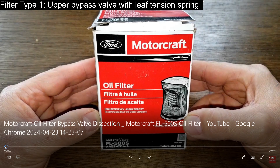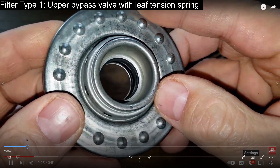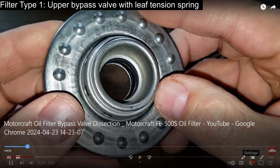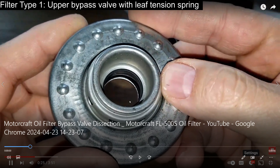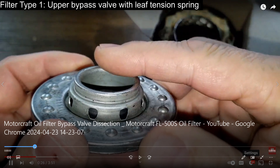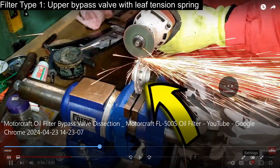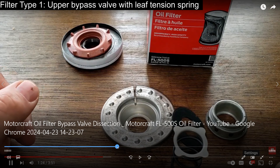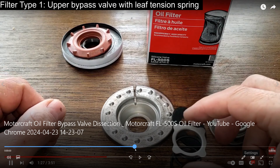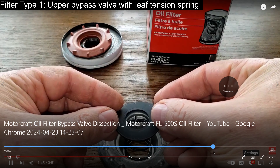Unfortunately I don't have examples of number one where there's an upper bypass, but here's Whip City Wrencher - I'll put a link in the description to his YouTube page. If you want to see all about oil filters, this is the place to go. So this is an upper bypass relief valve. You can see here he's showing it in this example, and what he does later in this video is he actually does the inspection - he cuts the bypass valve out of the upper, deconstructs it. You can see all of the parts of that bypass valve and he sort of assembles it back together and shows you how that works in bypass mode.